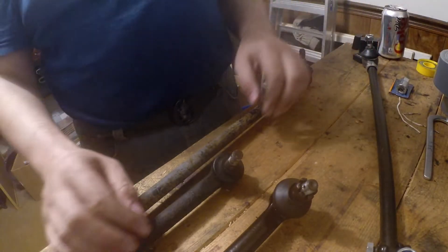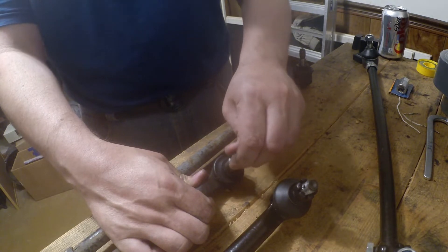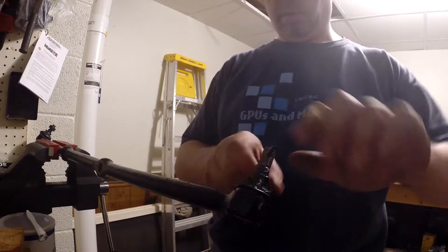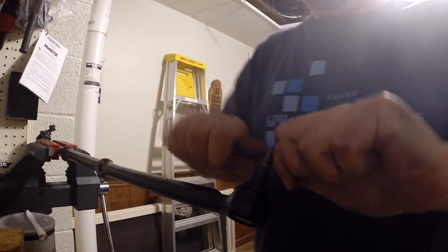Here's the tie rod situation. There's a little looseness in some of the bushings, but this tie rod is definitely the smoking gun — there's a huge slop, and it goes like this too, which it totally shouldn't. It should just rotate. The end of the main tie rod should just swivel at its socket. It should not rock, and it should not telescope in and out.